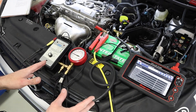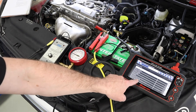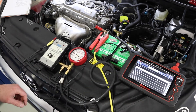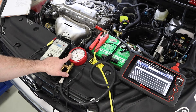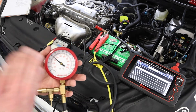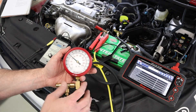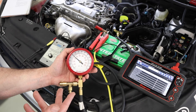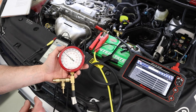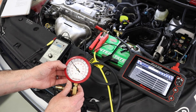I've got most of my hardware set up for the test. I know my OTC box is ready, I've got a gauge connected, and I'm going to use my scan tool to turn on the fuel pump and watch my pressure go up. The really important thing here is not to be concerned about exactly what pressure the system reaches, but to pay close attention to where we're at whenever I start this test.